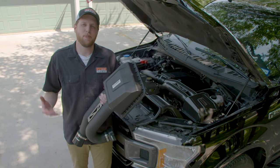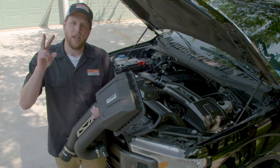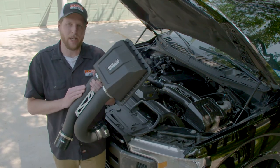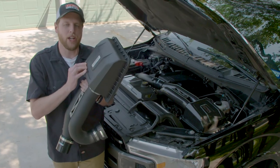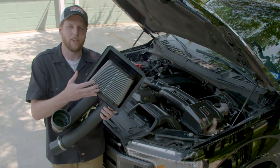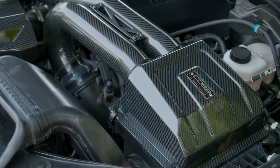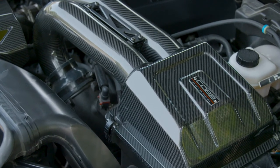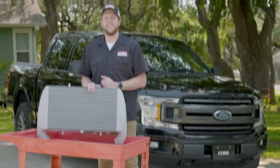Improving the tune is only half the fun of modifying a truck. We've got several high-quality bolt-on upgrades designed to work alongside the AccessPort. Swapping on an intake is probably the most popular early modification, so for the F-150 we made two. The Cobb F-150 intake features three-inch mandrel bent and powder coated intake tubes that mate to an injection molded air box lid sealing around a much larger filter with 165% more surface area than stock. This same design is also offered in complete carbon fiber as part of our premium Cobb Redline Series, plus we have coolant reservoir covers to match either type.